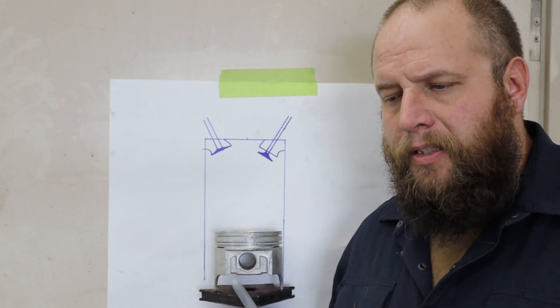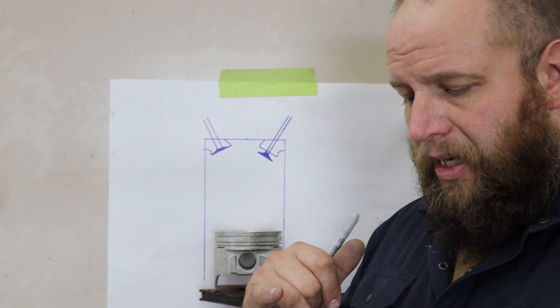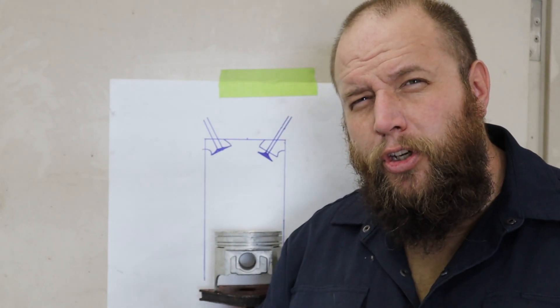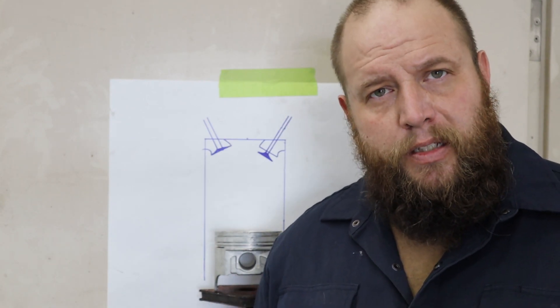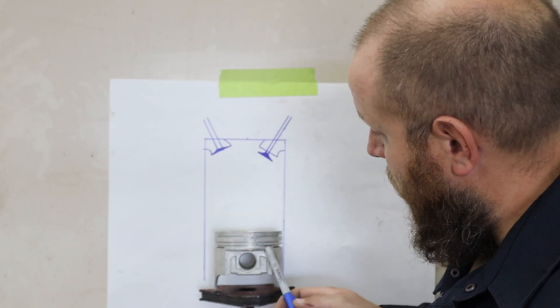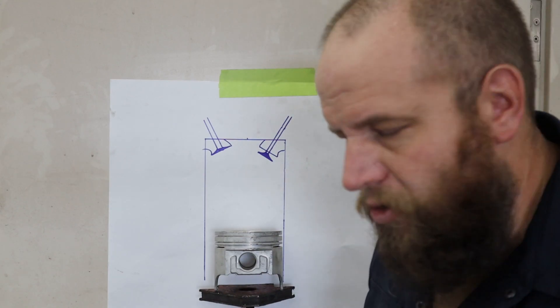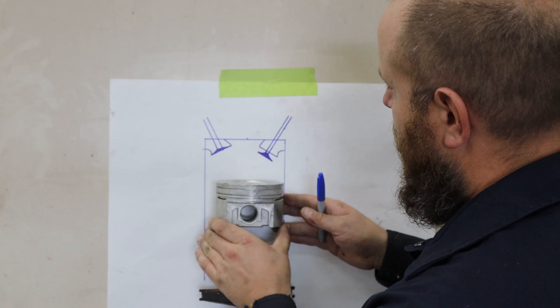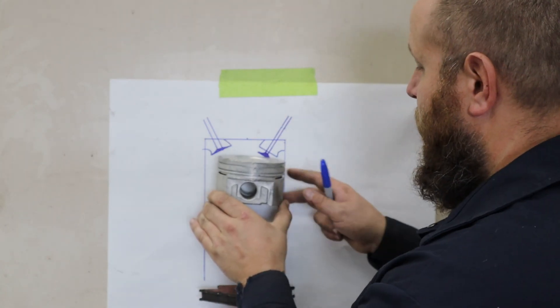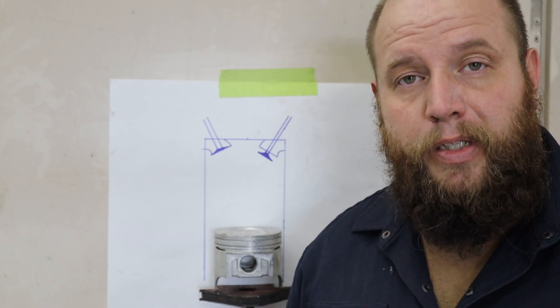Maybe one cannot simply watch and not subscribe. I decided to go through this anyway because I'm realizing that some people might not exactly get the terminology of what I'm doing here. So, when I'm saying top dead center, when I'm saying IVC, when I'm saying static or dynamic compression, we're just going to do a quick little overview of this. So, TDC — top dead center. This is our cylinder and this piston will represent a piston. We got our valves here and all that. TDC is when the piston is at the uppermost point of its travel — it can't go any further than that. That's why we call it top dead center. There's top dead center and there's bottom dead center.